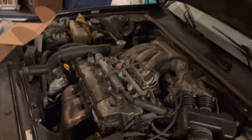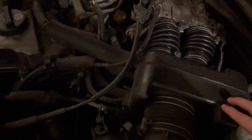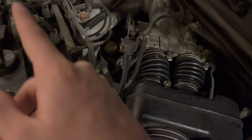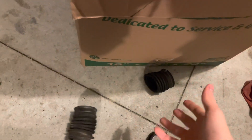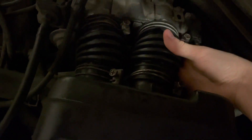Every time I get paid, I'm going to start replacing things. The first thing I replaced on this — I've replaced the spark plugs. There's a misfire, so the coil packs need to be replaced, so I got a new set of coil packs. And after the spark plugs were replaced, I realized that these hoses were absolutely dry rotted. Here they are right here — absolutely nasty, they don't even move. So I replaced these with brand new rubber hoses so it's not leaking air.